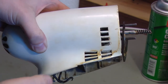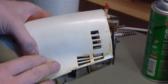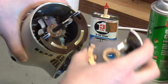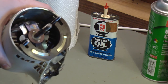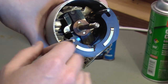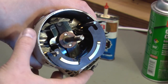I cleaned the outside of the case as best I could, trying to balance my desire to clean it with being careful not to damage the existing paint. It cleaned up pretty well. More importantly are all the electrical contacts — I used some very fine steel wool and polished those contacts. All the carbon I could get out of the motor housing is cleaned out. You want to get any carbon debris out of the motor because carbon is conductive and can lead to short circuits — that's probably what happened here. You get what's called carbon tracking, where enough carbon built up between a contact and the case that it actually drew an arc.